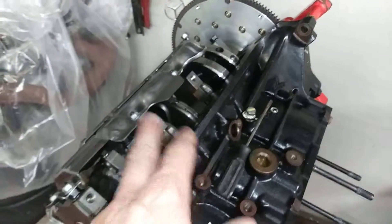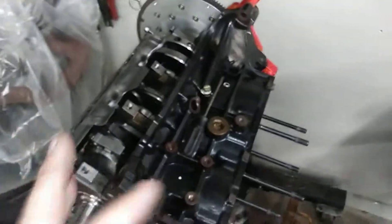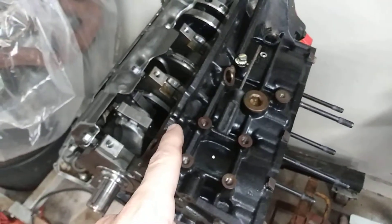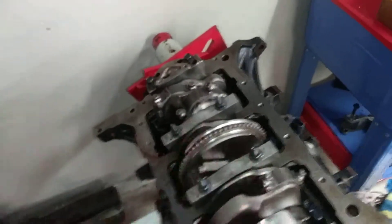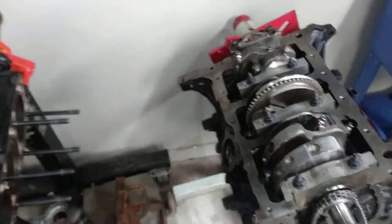You're probably going to have to swap the entire crank assembly over. The rods between the LX9 and the LZ9 — I believe the rod length is 5.9 inches according to GM, and the LZ9 is also 5.9. I measured mine at 5.827 and I've never measured an LX9 rod, so it's probably not easily interchangeable. You might have to finagle some things.